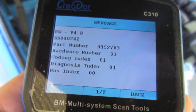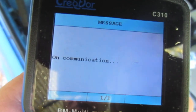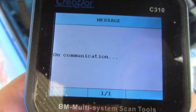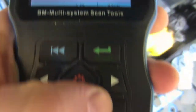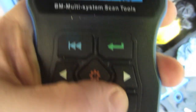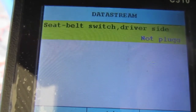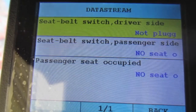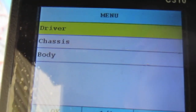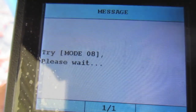What's your guess as to how many airbag codes we have in this race car with no interior? Quite a few. The other cool thing about this tool is you can read data in real time. You can check to see if your belt switches are working, if your occupancy sensor is working, or in check engine diagnostics you can see if your O2 sensor voltages are correct — and it really helps you narrow down what the problem is.